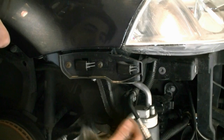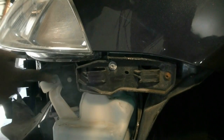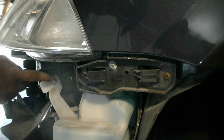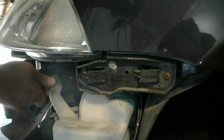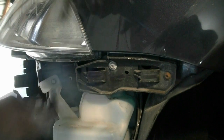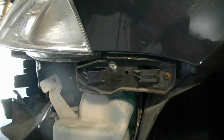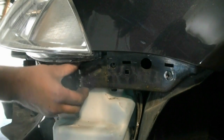Actually I'm going to leave this side because there's plenty of clearance here — just this one bolt on this side. On the other side we actually have a 10mm bolt for some reason, so we're going to remove that. We're also going to remove this bolt that connects the windshield washer fluid reservoir to the lock carrier. On this side we're also going to have to remove the bumper guide. With that bolt removed we can take this piece off.